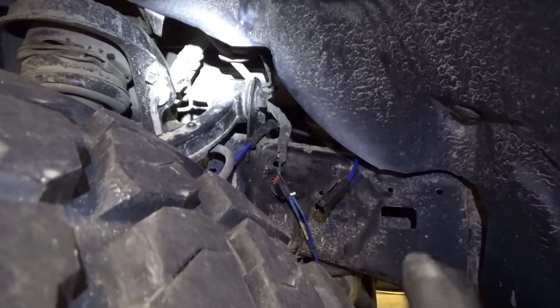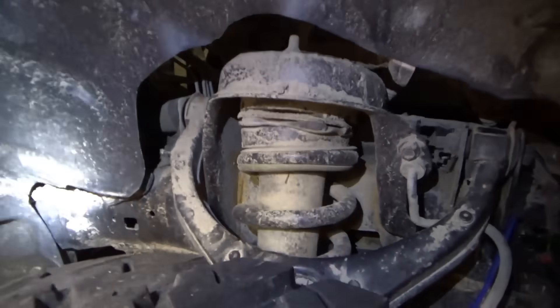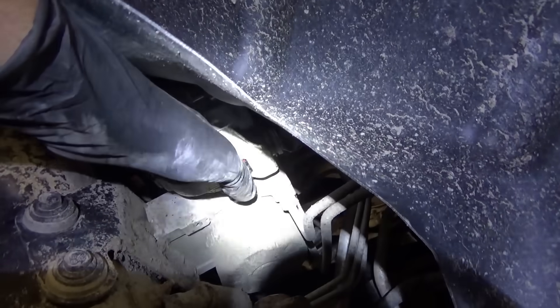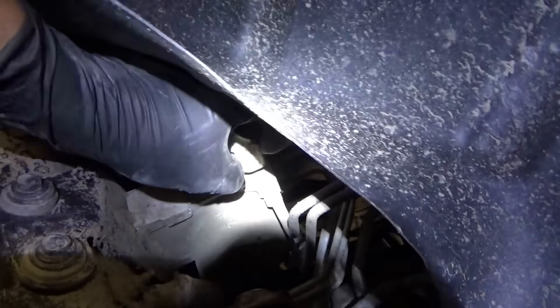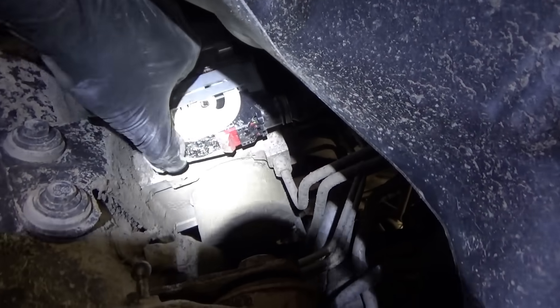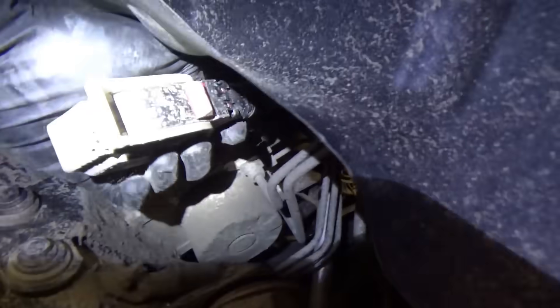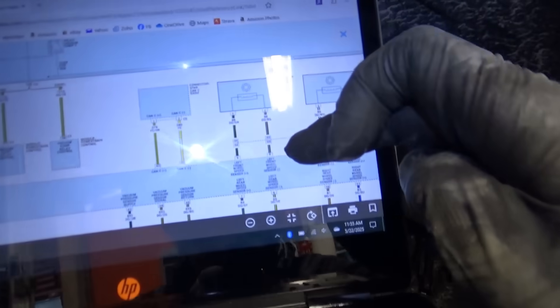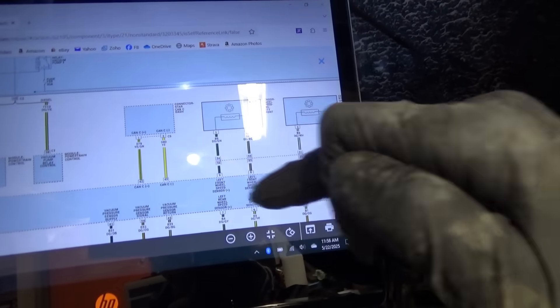It's not reading any sensor, so we need to go to the ABS module, look up a wiring diagram, and do a visual inspection on the wiring harness to see if there's a break in the wire. The ABS module conveniently lives right here. Keys off — we need a wiring diagram with this bulk connector. Thanks to AllData we have a nice OE wiring diagram. We're going for the left front wheel speed sensor — pins eight and nine at the ABS module.